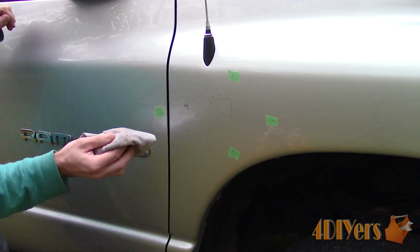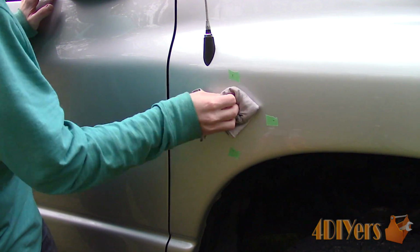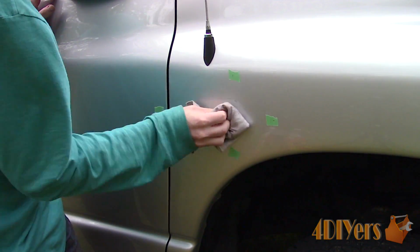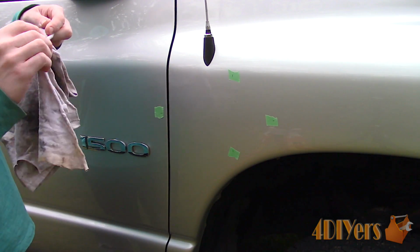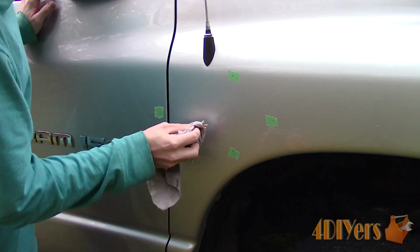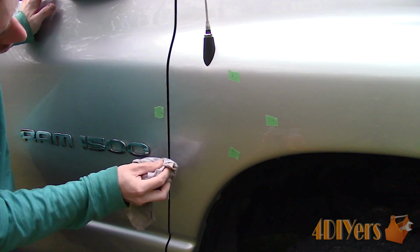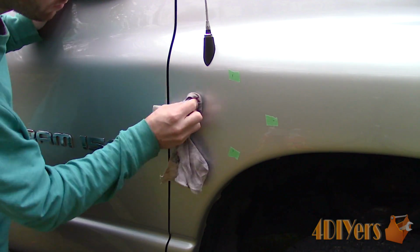If any adhesive residue is left behind, use rubbing alcohol and a clean cloth. A slightly more aggressive solvent that can be used is a wax and grease remover, or WD-40 also works too. If you are using WD-40, this will leave a residue behind that will need to be sufficiently cleaned, otherwise it can cause adhesion issues for a new badge.